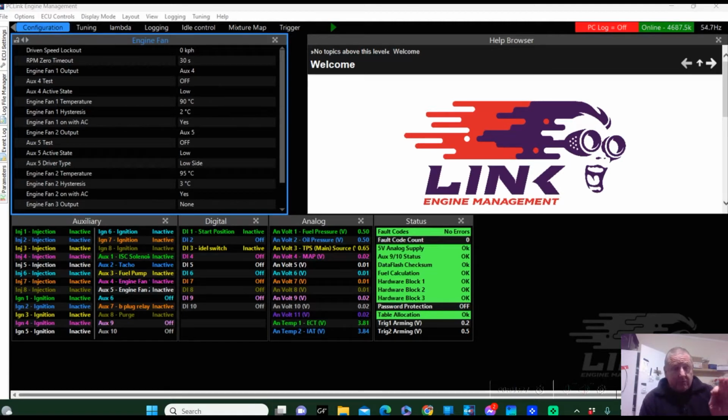Anyway, we're going to set up. This one is set on 12 tooth and 1 tooth home at present, so if the owner of this loom does put that on, which will be in his kit, he will need to change the trigger settings.